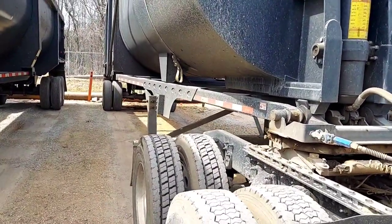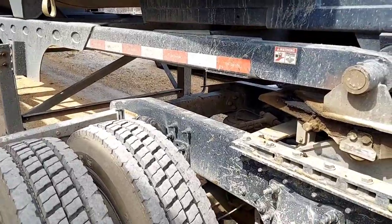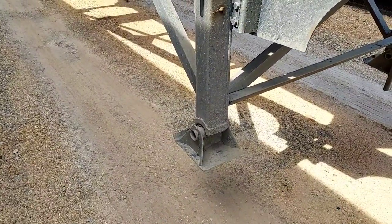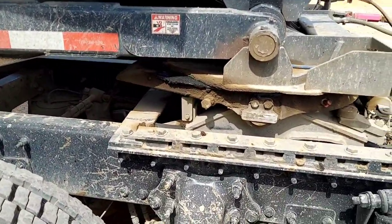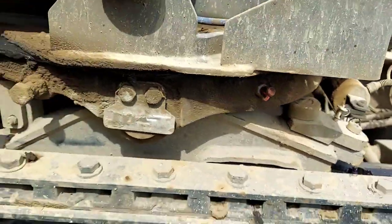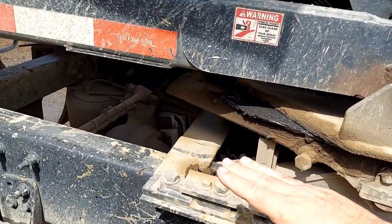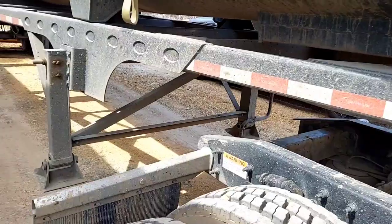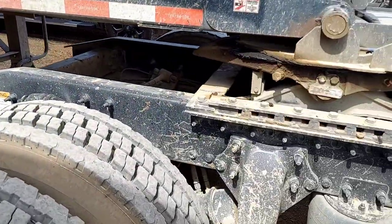If you've been following me, you know I pull a frameless trailer. Frameless trailers are different than van trailers and others. With a van trailer — or really any framed trailer — one thing you're going to want to do is lower the landing gear to the ground to take some of the pressure off your fifth wheel. I don't do that because this plate moves and there's a little gap right here. If I let the landing gear down, it's going to want to tilt up and make the truck ride up underneath the trailer, then just push the trailer backwards. So I don't fool with the landing gear — it's a waste of time, and you're probably going to tear it up.